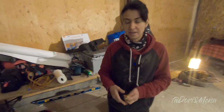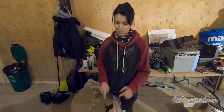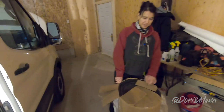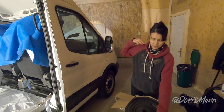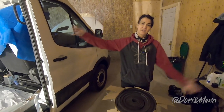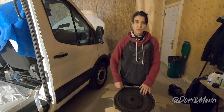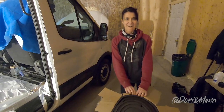We ordered the Mini-Cell online. eBay was out so we used a different retailer who was actually pretty quick — a good alternative if your usual suppliers are slow. We ordered 30 by 72 inches, it came in four pieces and we only used three. The floor layers will be: Mini-Cell in the corrugations, then XPS board, then plywood, then vinyl on top. There are some glues and steps in between, but that's it in a nutshell. We're hoping to get it done this weekend.